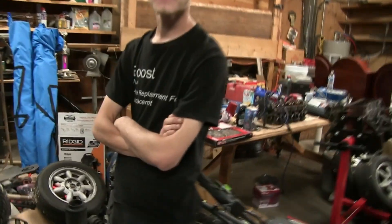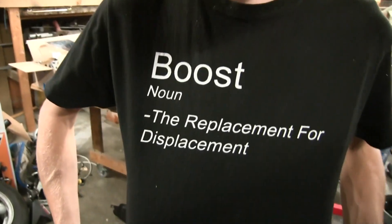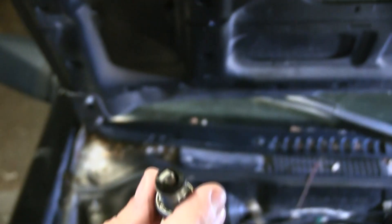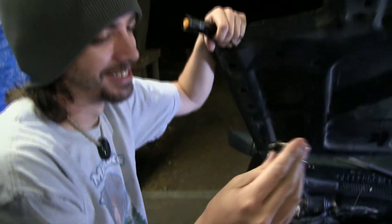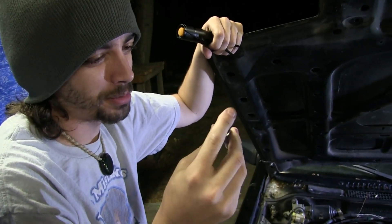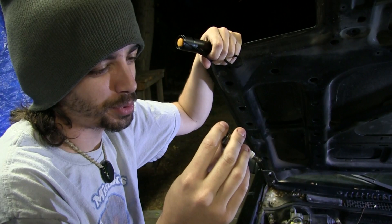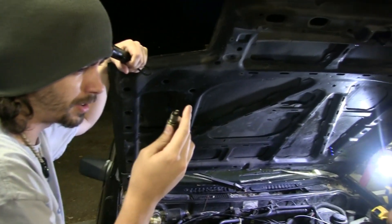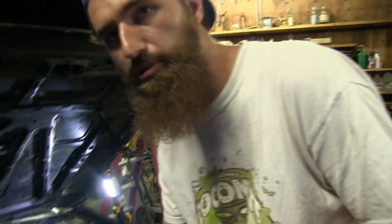Check out this spark plug, dude — now available on Amazon Merch. An interesting combination of rich and lean at the same time; I've never seen this before. You got a little bit of both flavors. It's not wet but there's a lot of carbon buildup — it's like Spumoni ice cream. It's pretty white on top. The gap isn't super huge either.